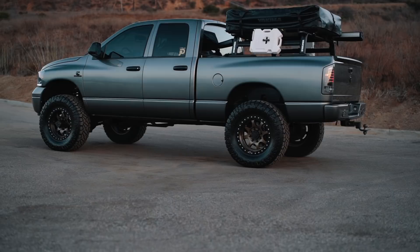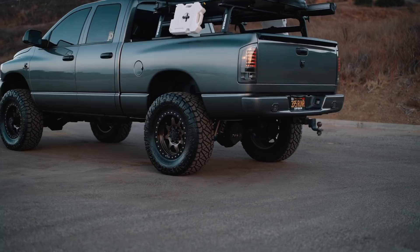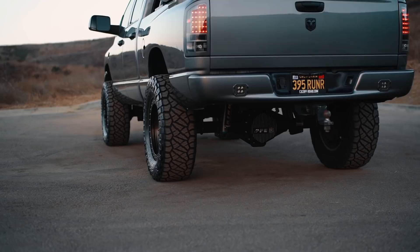I hope that helps you. This is a little bit of a boring technical video, but I get this question a lot, particularly on Instagram — people asking how I fit 37s on my truck. The biggest thing is going to be your wheel and tire spec, particularly your wheel spec. You just can't go into those negatives; you've got to stick around a plus 18 to plus 25 offset, especially if you don't want to trim. If you have any questions about your wheel and tire specs, comment below. Appreciate you guys watching — please subscribe to the channel, new videos every week.